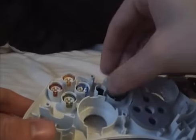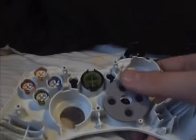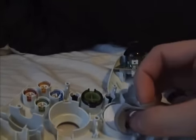Oh, by the way, that D-pad fix I actually found out from someone else on YouTube. Just 2 seconds, I'll find it. Her name was... There it is. Her name is Totally Lame Robot. She's got a few tutorial vids on there showing how she pulled apart a controller, and she makes a bunch of different things. But the main one I was interested in was the one about the D-pad, and she did exactly what I've done here. She just put something behind the touch part of this thing here, just to give it a bit more depth.